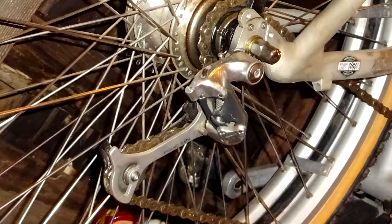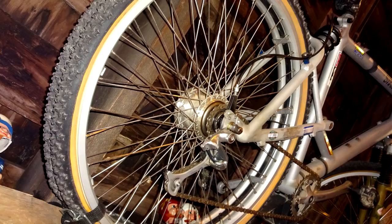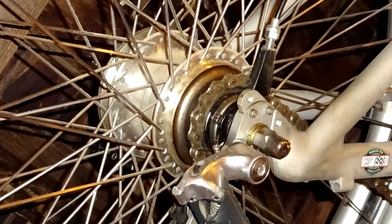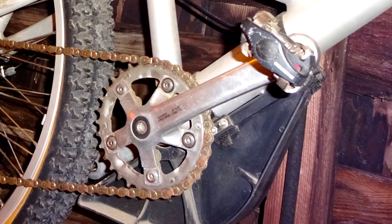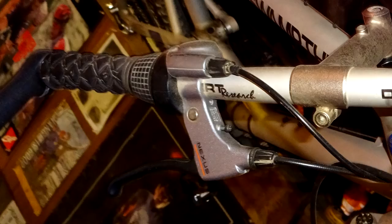Another feature of this rear hub is that I believe it would have had a roller brake, which may have been more efficient in wet muddy conditions than rim brakes. It doesn't look like he added spacers on the rear, so the stock spacing of the Shimano Nexus hub might have been fine. My guess is he probably had to play with the bottom bracket width on the front to get the chain line correct.